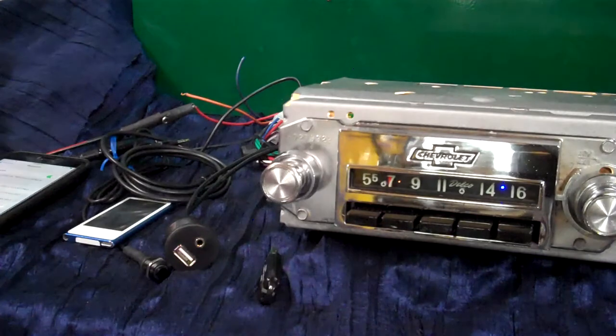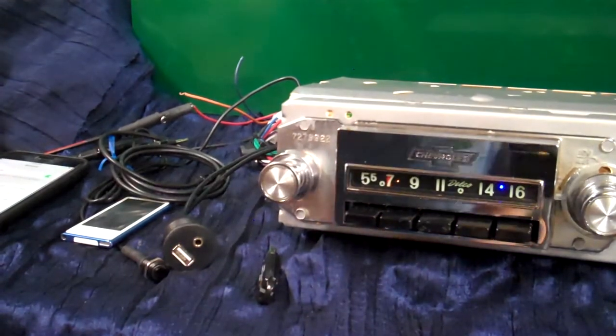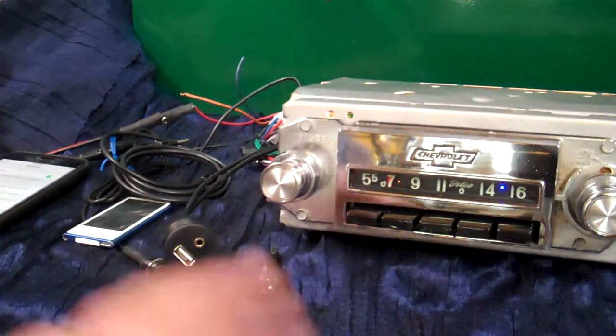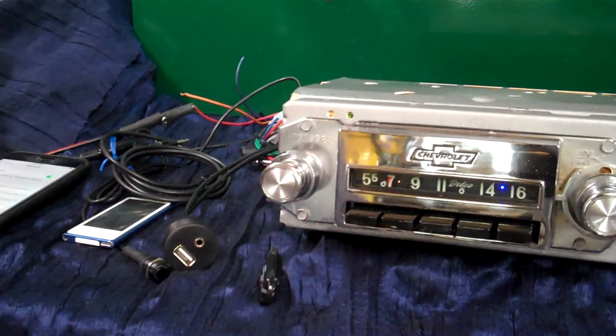We've got an original 1965 Chevrolet, I think it's a Nova. Nova SS 65, original AM radio. The radio's in good shape. We repolished everything, push buttons and all, and redid the background, polished all that, and we did a full Aurora design conversion on it. It now has AM FM stereo. Four channels out, 45 watts a channel.